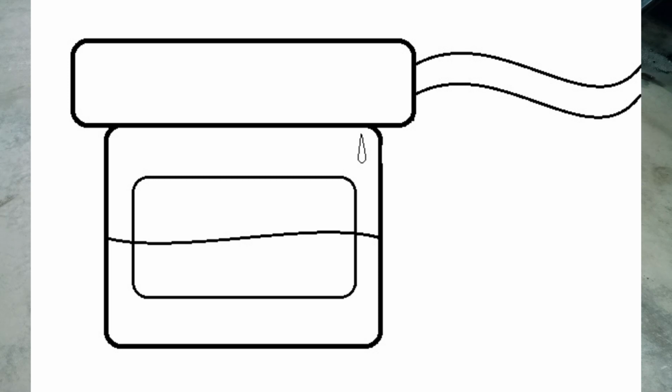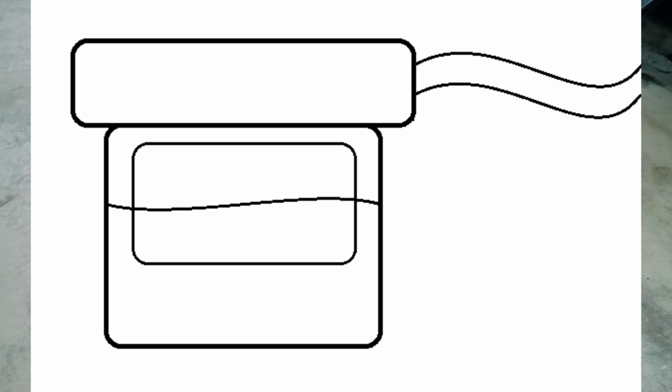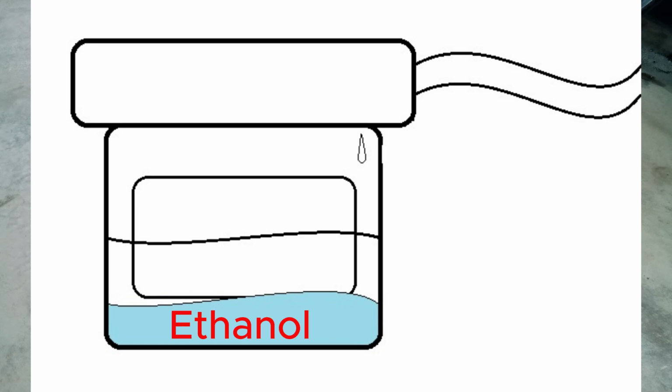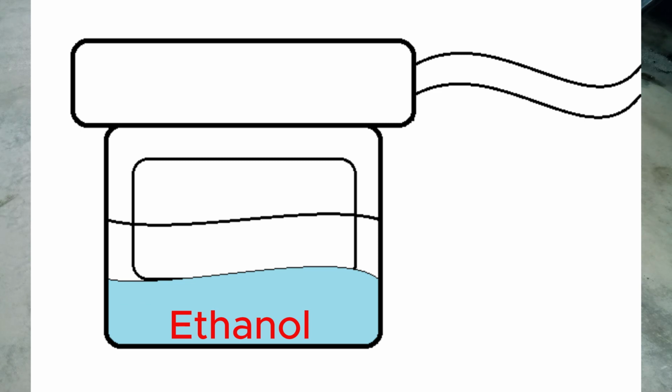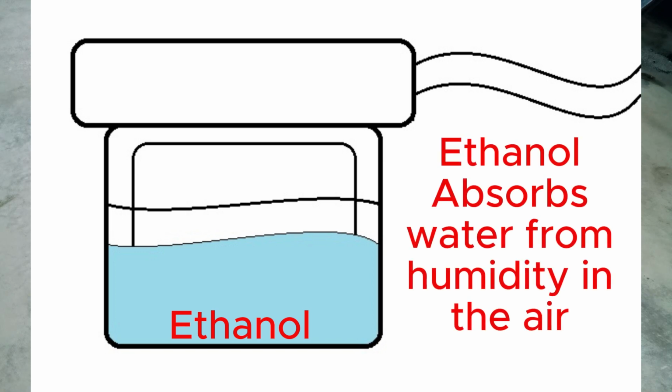So my theory is that the ethanol either isn't evaporating off at the same rate as the gasoline or not evaporating at all. So after sitting for several months, and who knows how many cycles of the float bowl evaporating and refilling, you're left with a high concentration of ethanol sitting in the float bowl. This is what turns into that sludge and causes the damage.